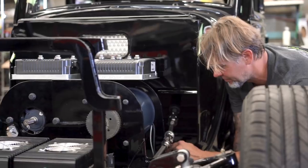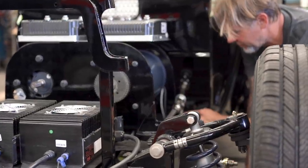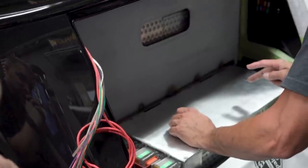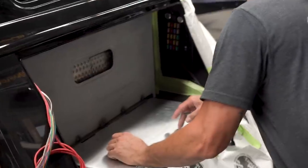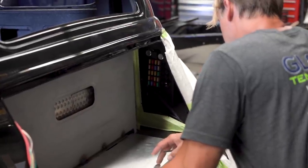We're not going to go from one to another in series. Because if we plumb in series, the temperature differences between the batteries is going to be all weird. So we're much better off just having an inlet and an outlet, like we would with the block. The big choke point is going to be the lines that go from the radiator to the manifold — that'll be the biggest determinant of how well it cools.